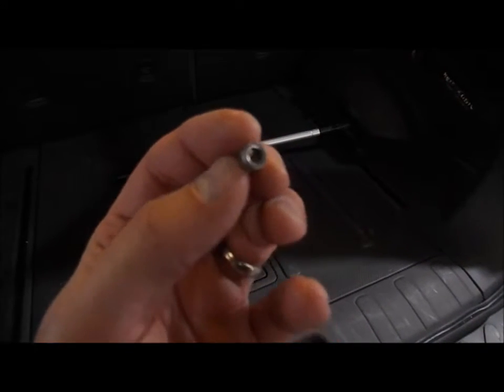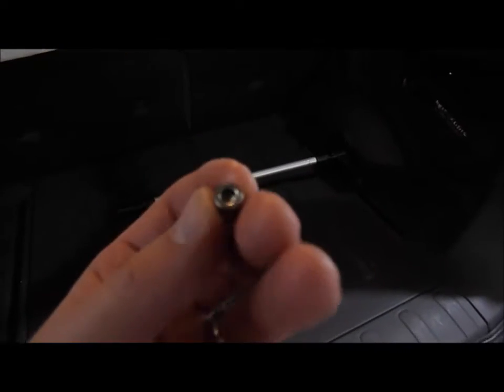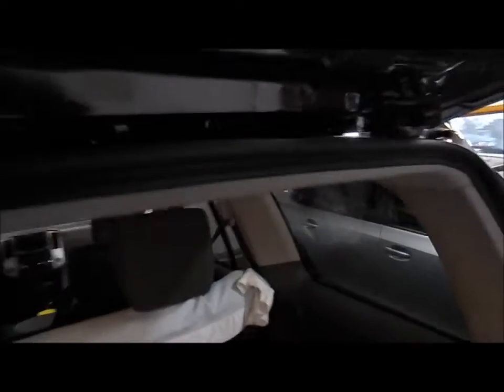I think they're five thirty-seconds long or something like that. It just says to put those in the threaded holes — there are two threaded holes in the bracket, one there and one in the middle of the frame. You just bottom these out. I may want to put Loctite on these at a later date so they don't back themselves out. It's nice that they're stainless.